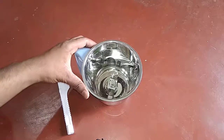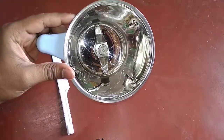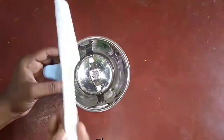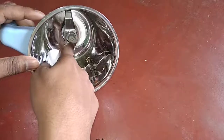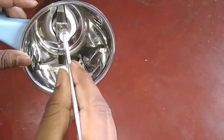Hello friends. Sometimes it is required to remove the blade of the mixer jar for proper cleaning. You can remove it using the plastic knife which is available in the mixture packet — this is for cleaning. You can see there is a six-headed thread, and the same six-headed nut is available, so you can just put it into that nut.